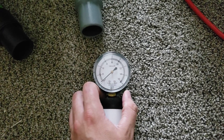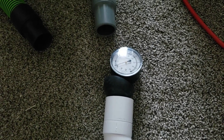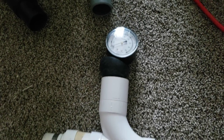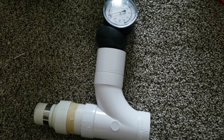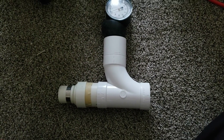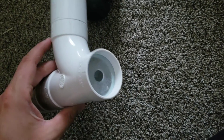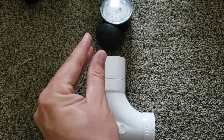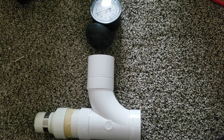I feel that working vacuum isn't a good performance indicator. It has its uses — if you were looking to figure out how well a machine would run a turbine tool, this would tell you which of these machines would run a turbine tool better. And it can be used to look for leaks in central vacuum piping, because if you're not totally blocking them off, the suction can't pull things together to seal off leaks. I just don't think measuring cleaner performance is really one of them.